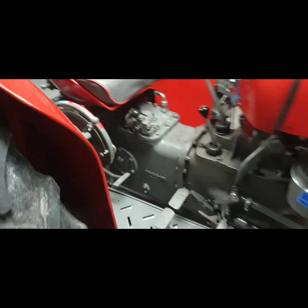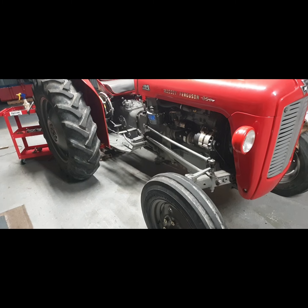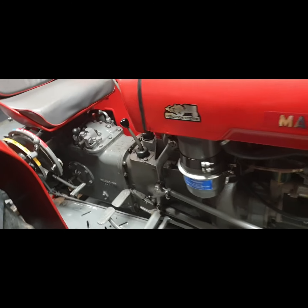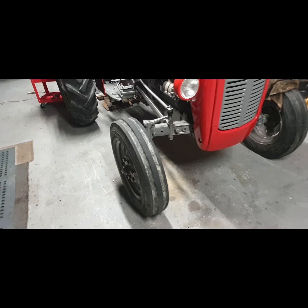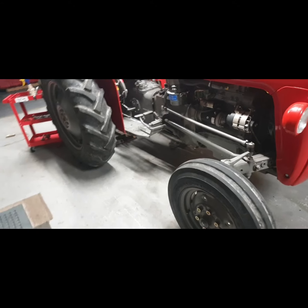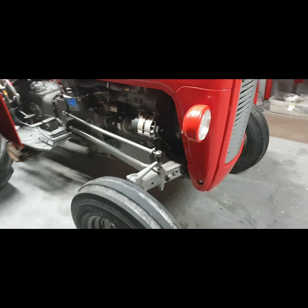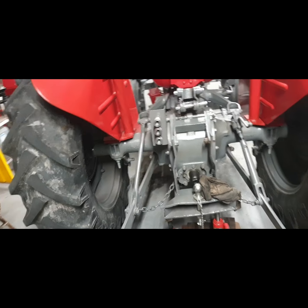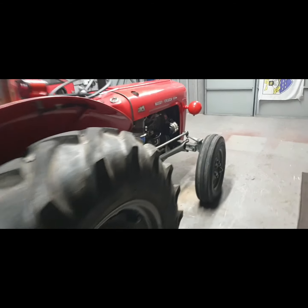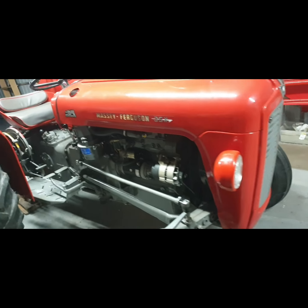We are getting towards the finishing touches. I'm waiting on three more parts to come — I was told they're in the post today, so they'll be here tomorrow and I'll be able to get back to the final few bits and pieces. After that I need to do the tracking on the other side and then the final adjustment to the front wheels — the quarter inch toe-in. Then I hope to take it on a test drive, make a final tweak or two to the brakes, and make sure the steering is A1. I also want to give it a good looking over, make sure all the seals I put in are sealing, and might just put a bit of polish on the bonnet to bring out the best of the paint.